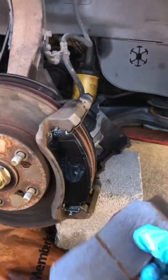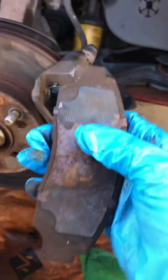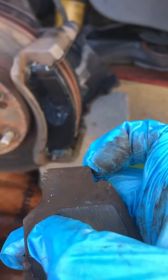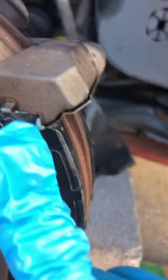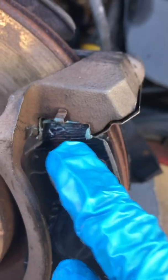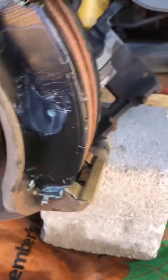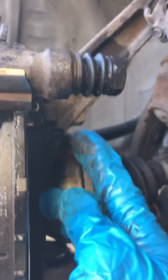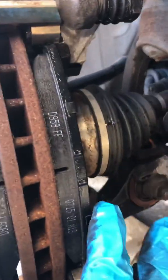I did take the new brake pads, as I showed you before. This is the old one here, but I just greased up around the little arm here at the end, because it slides back into that metal bracket we cleaned. There it is, sitting in there, that little clip. So I greased around the end, that little arm, so that it'll slide in and out on that clip better. I've got the new pad in. There's that guide up there on the top, inside. Got the new pads, there they are on each side of the rotor. You can see them there, looking good.